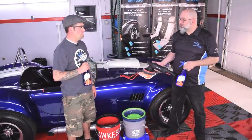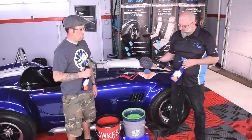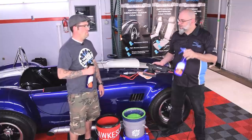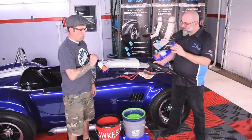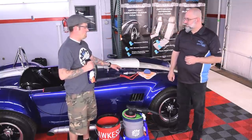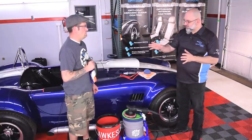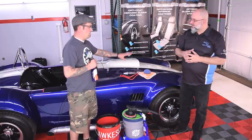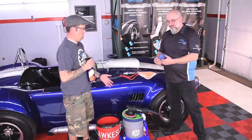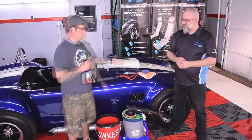So today we polished and gloss coated the Rag Cobra. We used the Zen Tool 21E polisher with a waffle pad, prepped with O&R in the Optimum Pad Washer to get it nice, damp, cool, and ready to polish. We used Optimum Hyper Polish for that glossy shine, then finished with Optimum Paint Prep to make sure the paint was as clean, naked, and oil-free as possible so the gloss coat could cross-link into the clear coat. We used the Wizard towel for the paint prep step, and the Knight Rider towel to level out and remove the coating for that great shine. Then we cleaned the applicator pad in O&R — and once it dries, it'll be perfect and ready for next time.